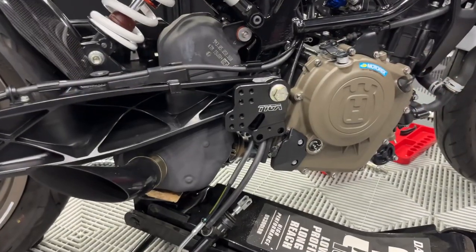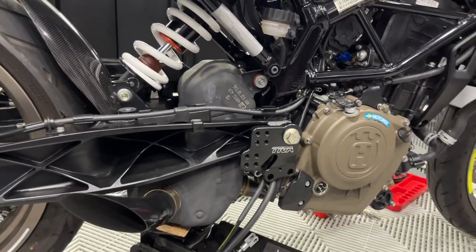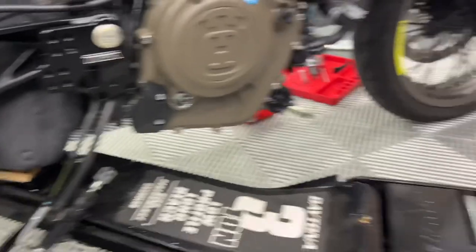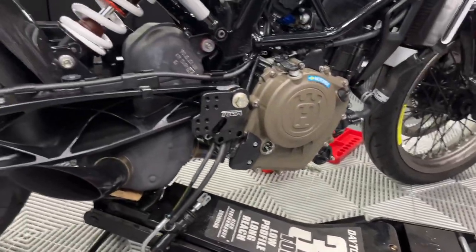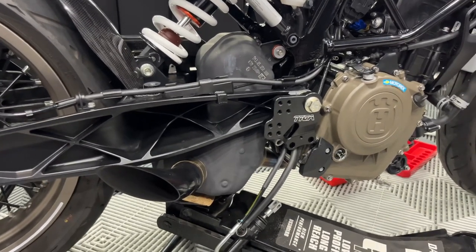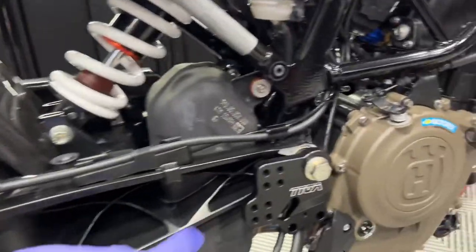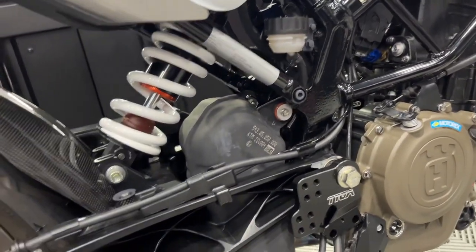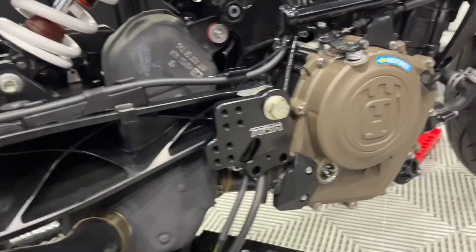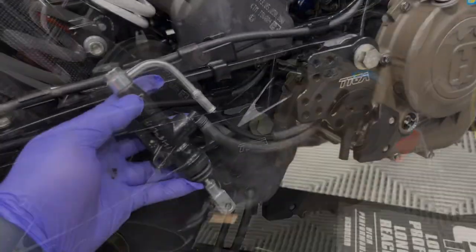We have our first side plate on. It takes a little finagling with the jack — you do have to go up and down with it. At one point the swing arm was way below where I needed it because the jack handle wasn't fully tightened and the pressure was slowly bleeding off. The bike is unstable, so be very careful not to topple it. Even with the fastener out, the swing arm is still connected in another area, so it's unstable but not totally disconnected.